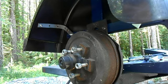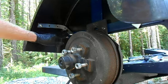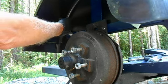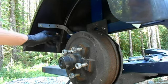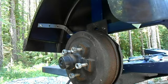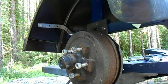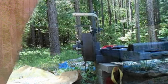And the reason for that is I'll then disassemble the fender, then put each bracket back in place with pop rivets from the back side, so it will be basically flush. That way the brackets will be in place, and I just have to take that nut and bolt out whenever I want to take the fenders off. The brackets will stay put. That's my idea anyway. Wish I had a welder to play with, but I don't, so this is what I have to do.